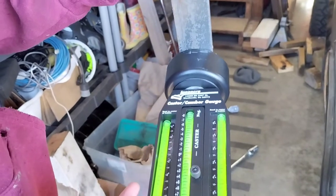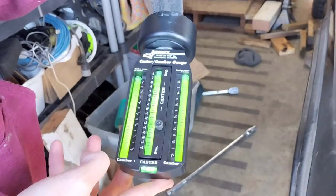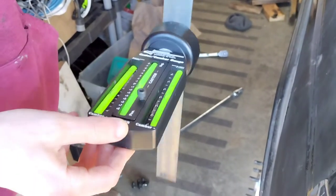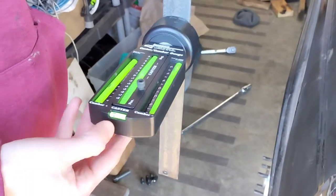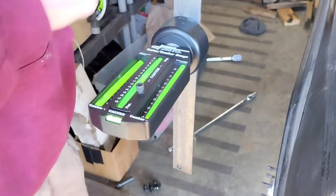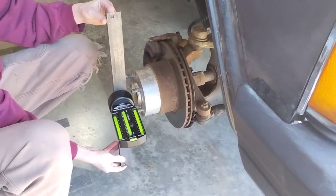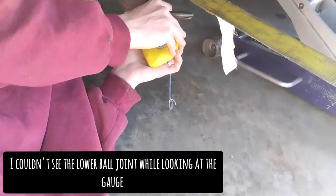The only way I know to do this right — you're going to have to go buy a tool. I don't have any creative approach that doesn't require spending some money. You've got to go get a caster gauge. This tool is pretty simple — it's got a big magnet on it and basically allows you to check your positive or negative caster. You essentially set your gauge level; I've connected it to a piece of flat metal and I'm going to hold it up to my ball joints and get the angle about right. I'm going to use a little chalk line.